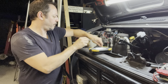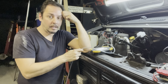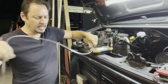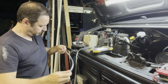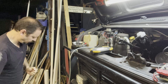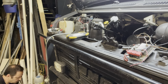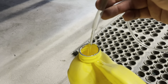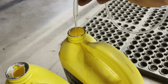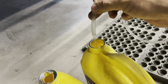If you go to the trouble of spending some money on antifreeze, which you should, and you have to take the radiator back out the way we are, you don't want to just waste all that. So I keep some of this clear tubing - you can get it at Lowe's or Home Depot, it's really cheap, a big roll for a couple bucks. That's a lot cheaper than even one jug of coolant, so you can hopefully recover some of it. I keep a couple of these empty jugs around anyway to throw water in if I've got a leaky radiator.